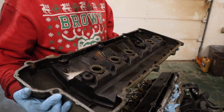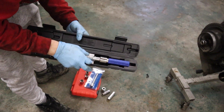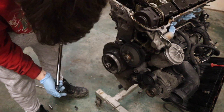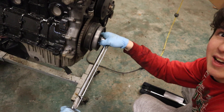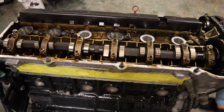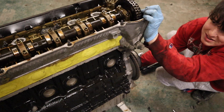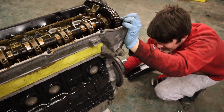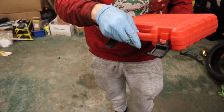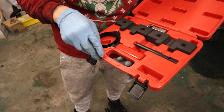There we go, that can come off now. I got this brand new torque wrench just for this job, but we're not torquing anything down right now - just twisting the engine. You hear that noise? That's compression from the cylinders - pretty cool. You want to twist it to top dead center. That's why I'm fighting so much force. This beautiful invention on Amazon for like a hundred dollars is a timing tool for a VANOS engine.